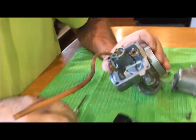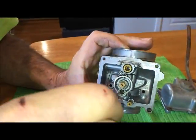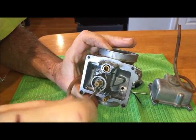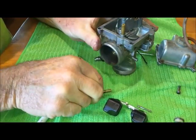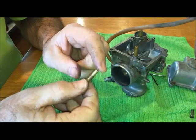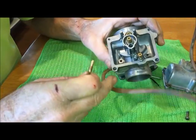Once you've gotten this far, you're almost done. This hole here is where the pilot jet is. In the book, on stock, it says 60 — I don't know anybody running a 60. Because of my elevation, even at sea level I'm running a 58. This is a 55 pilot and the bike seems to run best at that level.